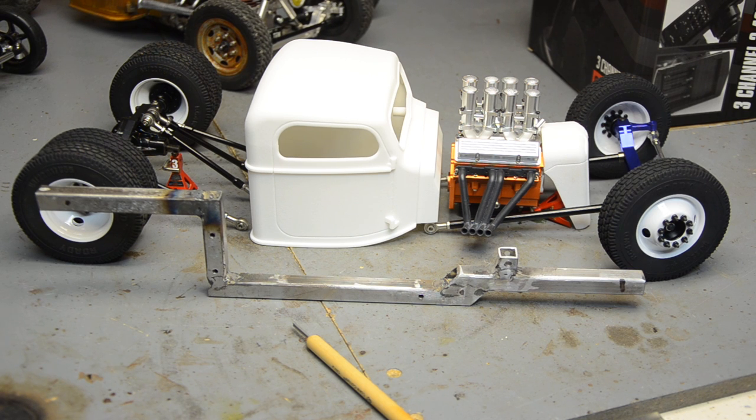You're going to have one on each side of the engine and a transmission crossmember holding it all together. Plus, I needed it a little shorter. So I did it like this, so when I cut the frame in half, everything's balanced from side to side. There is no wonkiness in trying to measure this raw steel and mark holes and cut them. It makes it a lot easier to do as much of the drilling like this before you separate the frame rails.